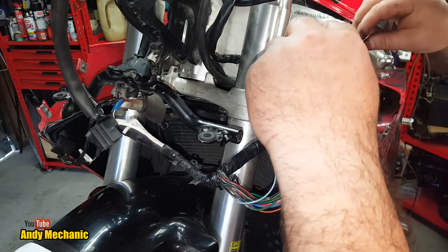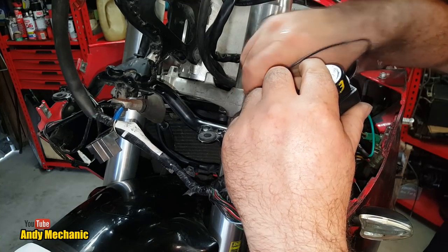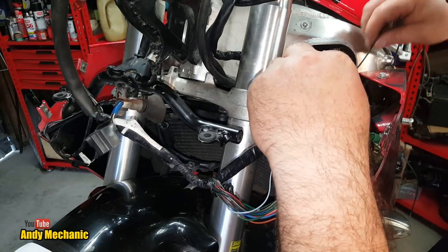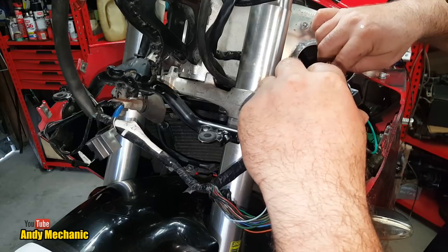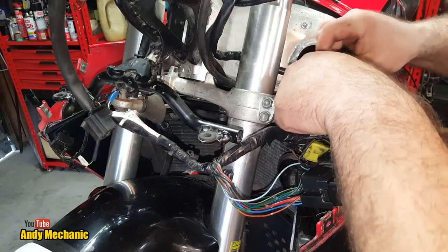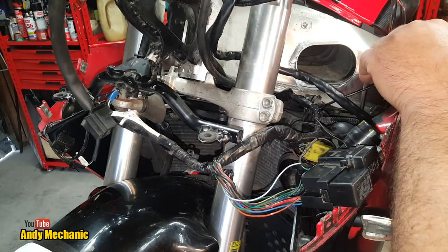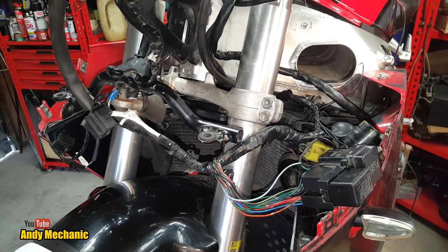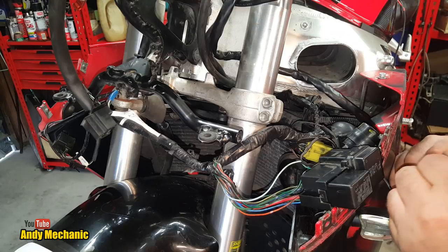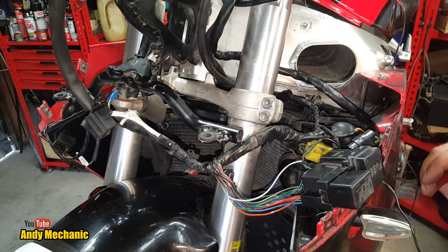to it. So as regards the length of wire that we need for the ground, just thread that through there, look. There we go. It's going to sit around about there, and there's the ground I'm going to use, so that should be about enough, I reckon. So we'll just snip that and pull it back out, maybe give it a little bit extra. There we go. Pull it back out, and I need to find an eyelet that's got a 6mm hole in it. And we'll crimp that on there.